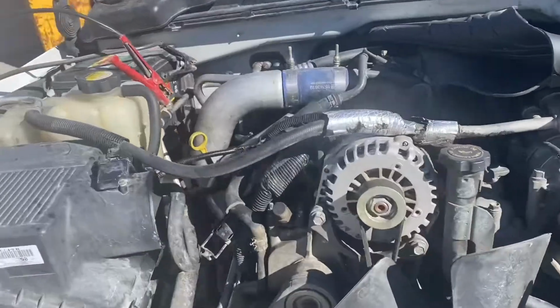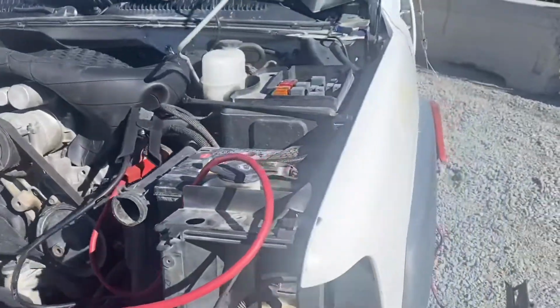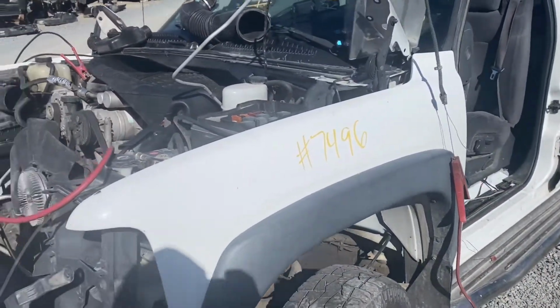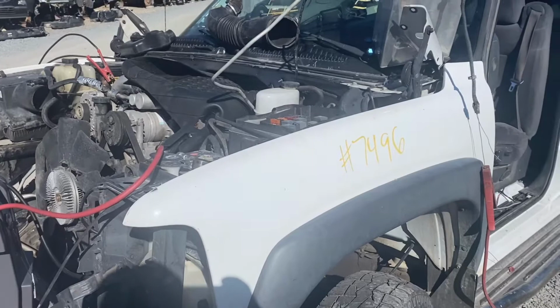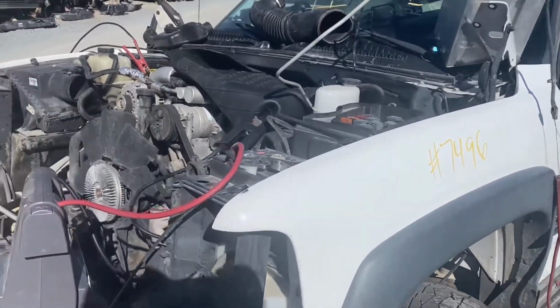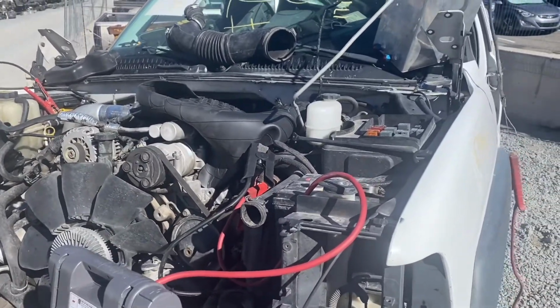So of course feeding it, release the bleeder and sprayed fuel everywhere. So got fuel, and this thing should start. I've had to crank on these Duramaxes before with everything in perfect optimal condition for 45 minutes before to get them started. So pretty common once they lose prime to have this kind of issue. So we'll see.